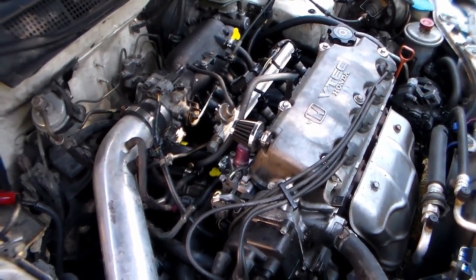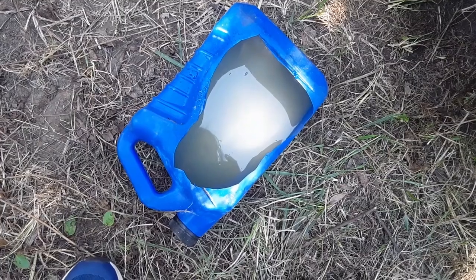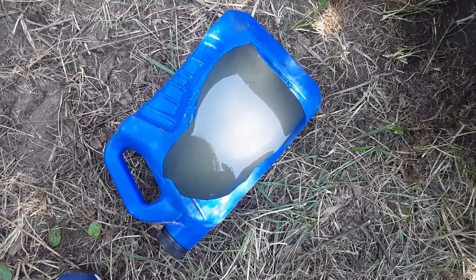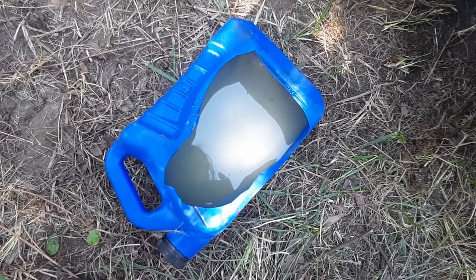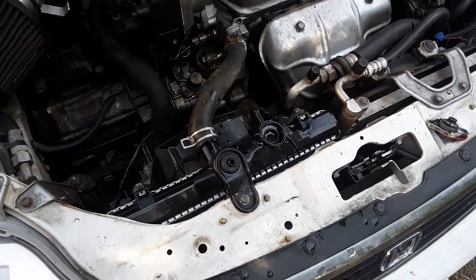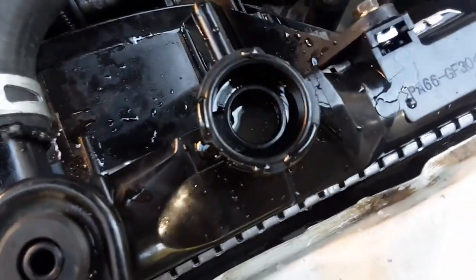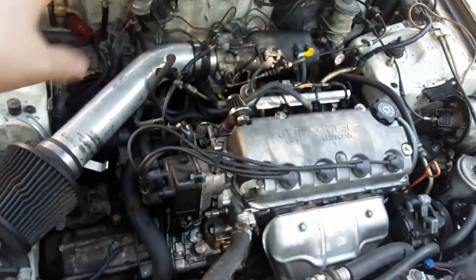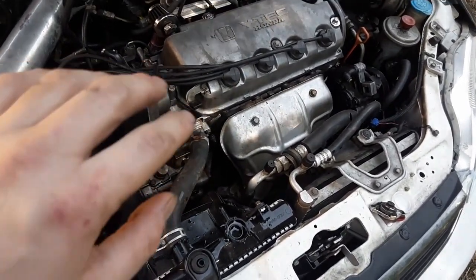After this we'll be able to move on to suspension, and there's still another motor mount I've got to replace. This is what water, green conventional, and copper seal looks like when drained back out. The whole oil jug was cleaned with brake cleaner — there's not even a lick of oil in there, that's all what came out. I flushed the cooling system once and got the radiator flushed a couple times to get most of the yuck out. There's still a little bit left — some copper seal floating around. Going to need to get the battery charged, get it running again, warm it up, and flush the system a couple more times until it's nice and clear.